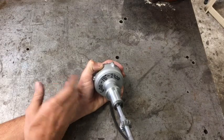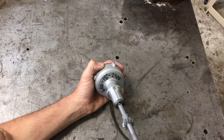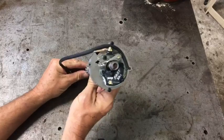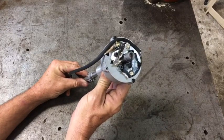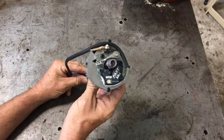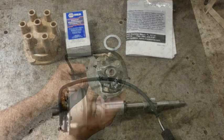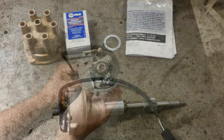Unfortunately, over the years we have a lot of people who ignore this and just stick it in the motor and time it by ear. That is a surefire way to have a disaster. If you follow the directions and use a timing light, it is a foolproof system. We will have other videos on ignition systems, particularly timing them. For right now, I just wanted to give everybody a good look at what's on the inside of a modern Corvair ignition system as manufactured here in the shop. If you like what you've seen, please remember to subscribe. There's plenty more coming and we'd like to stay in touch with you. Thanks very much, we'll see you out there.